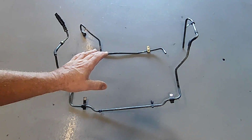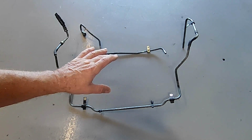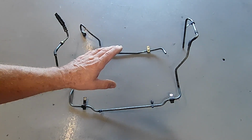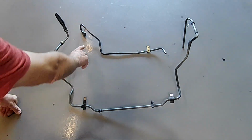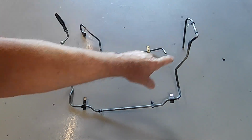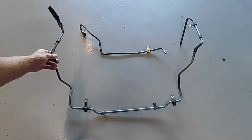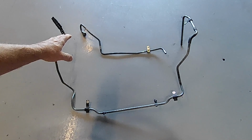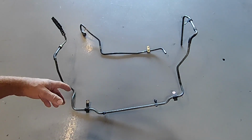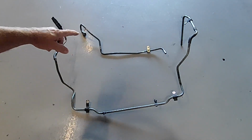As far as I can tell, this is due to Nissan wanting to reuse a lot of the components on the left-hand drive US vehicles, because on the US vehicles this fitting here is on that side, so you need to get from that side all the way back to the reservoir on this side, hence you need this. But on the JDM versions you don't, and in my uneducated opinion, folks, I feel that's probably what they've done. I just can't see any other rationale for having all this plumbing to go from there to there.